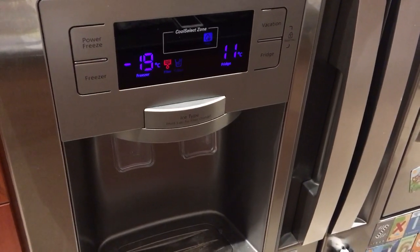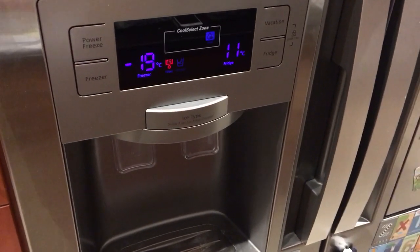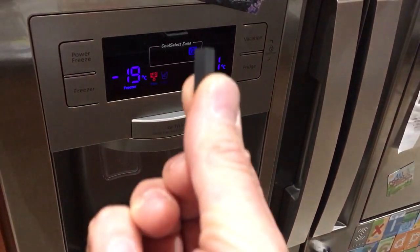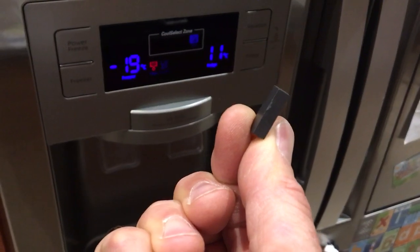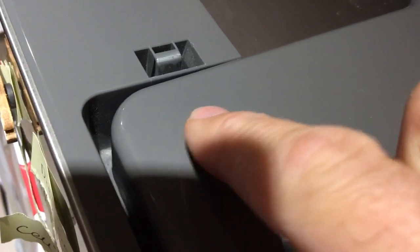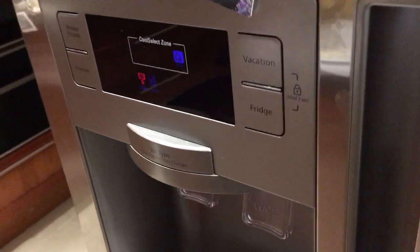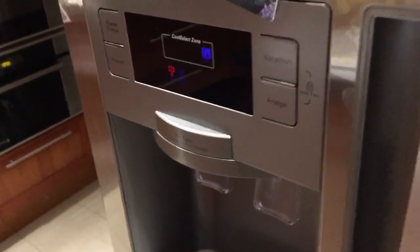Watch the display. It's not going to go off because I have this in my hand. This is a magnet that sits in here. I'm going to pop it back in, watch what happens. Magnet's back in and it says switch on here, if you can see that on your fridge. Display... two, one, gone out. That means it's working again.